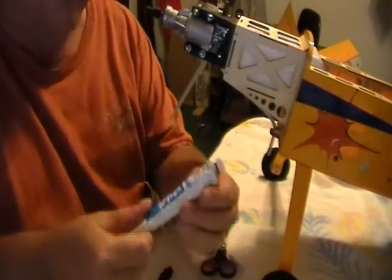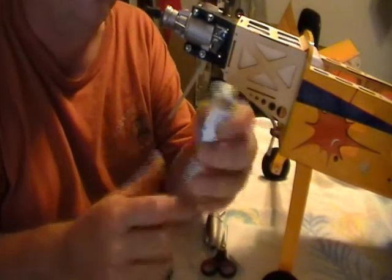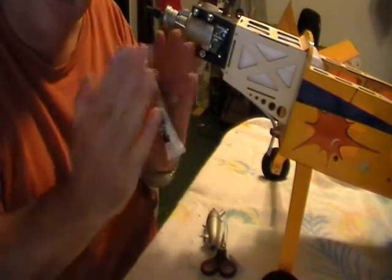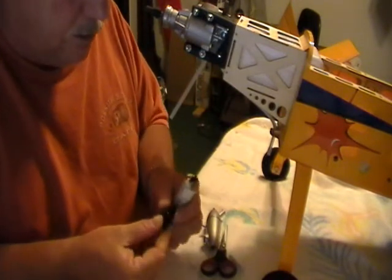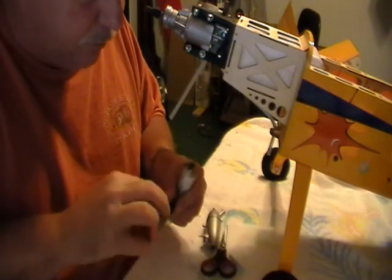Alright, this is just a heat gasket sealer. You can get it at an automotive store. On 4-strokes, the pipes go in on a header, and not like a 2-stroke where they fit flush with 2 bolts. This actually screws in. If you don't put sealer around this, it will leak air around these threads and leak fuel a little bit.